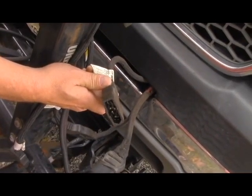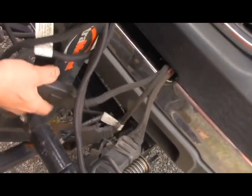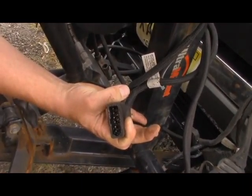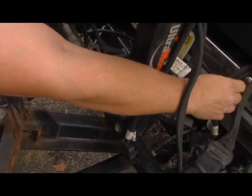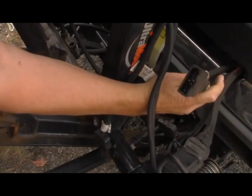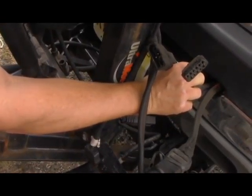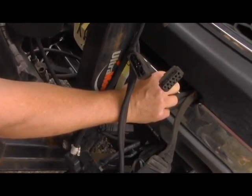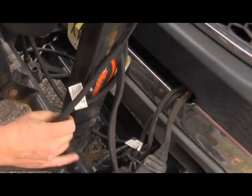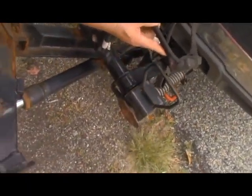This would be for making the plow move the valves — this is going to operate the valves. So this is the truck side. The other plugs that we have: this plug here is the 11-pin, going to go to the headlights of the plow. On the vehicle side, you have this plug here which has the control harness, and that's going to plug into the lighting harness. So these two are going to be plugged in together on the vehicle side, these two on the plow side, and then this plug is just the power ground.